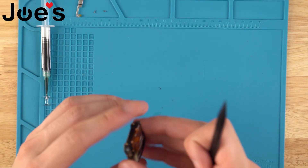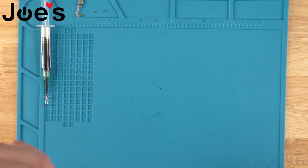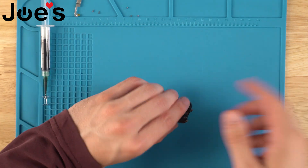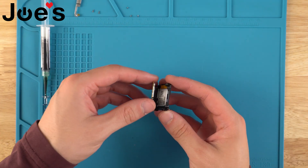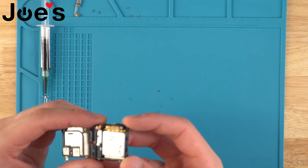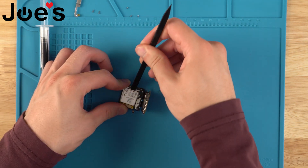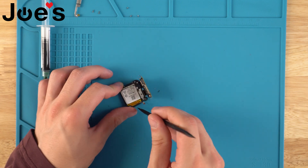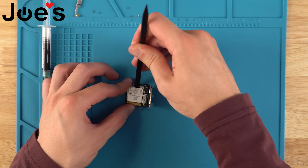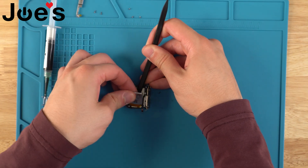As you can see, we've got our battery in here. So we're going to go ahead and unscrew the board using our Phillips screwdriver. Once you've removed all four of those screws, you'll just fold back the motherboard and you will have access to the battery. Take our plastic spudger and we're just going to get a little pry out of there and pull that battery out.